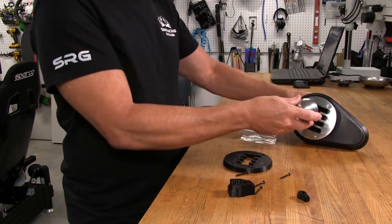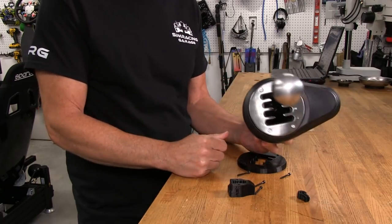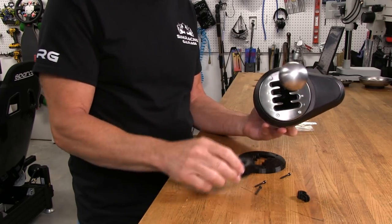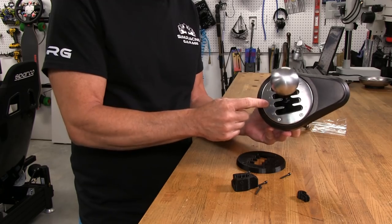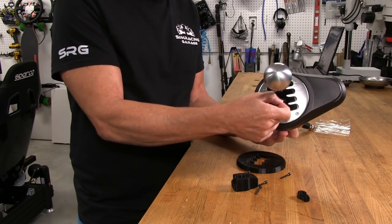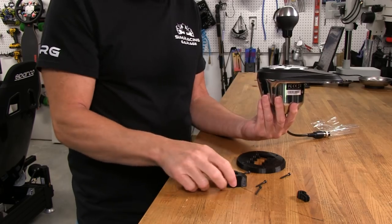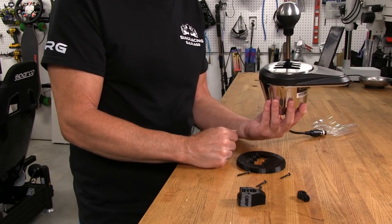What I'm going to do is take this a little differently — I'm going to pull it apart and pull the metal housing off the bottom so we can better see exactly what this is doing and where it's sitting in the assembly. Now, you don't have to do all that. All you really have to do to put this in is take the metal gate off, take the little plastic ring underneath and get that loose, snip a little zip tie in there so we can get it loose over the shift lever, and simply slide this down and lube it.